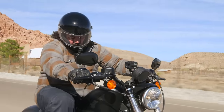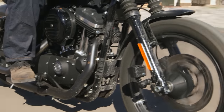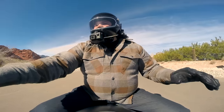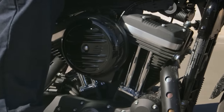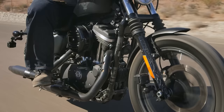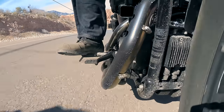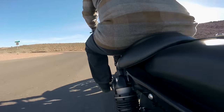But it's not all peaches and cream on a Sportster. Look down here by my toe — you can see that my exhaust pipe and front motor mount are covered in motor oil. Harleys aren't known for being the most oil-tight bikes around, and unfortunately that's the case with this Iron too. The Iron is also a very loud bike — not just the exhaust, but the engine itself. You can see the pushrod tube covers; this is a pushrod V-Twin making plenty of mechanical noise in the valve train. There's also some piston slap. See all those fins? It's air-cooled, and they build these a little on the loose side, so you will hear piston slap. Those loose tolerances are actually what allow Evos to live happy, long lives — it's part of the reputation the Evo has earned as a very bulletproof motor.